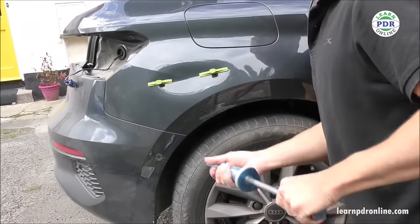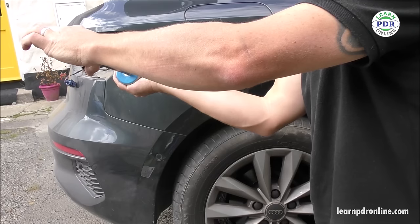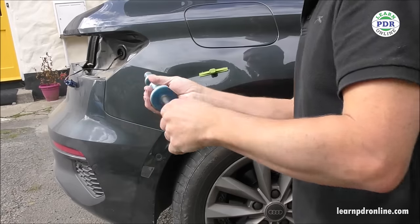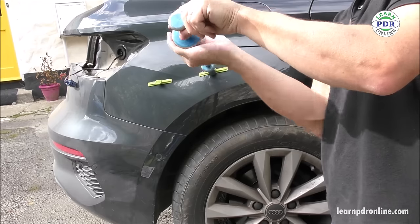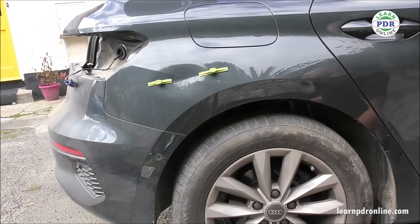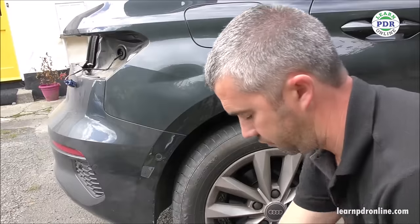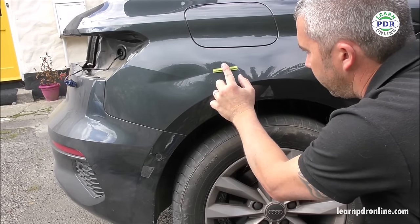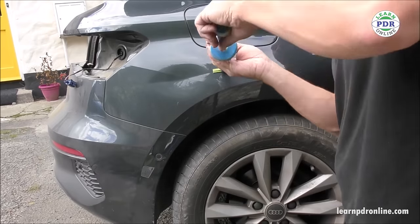Allow that to cure just for a few seconds before setting up my slide hammer. Now watch the direction of my pulls - I'm directing the slide hammer to the left, and that is allowing some force on the tab itself to help me direct that pulling force in towards the centre of the dent. And then the same on this side, pulling and directing the slide hammer in the direction I want that pull. Already you can see it's massively reduced the outer size of that dent. A lot of people think with a slide hammer you're just pulling it straight out, but you can definitely direct the force of that energy in that pull and help persuade that metal to go in the direction you want to feed it. It's all about that metal flow.